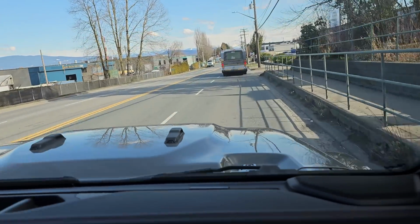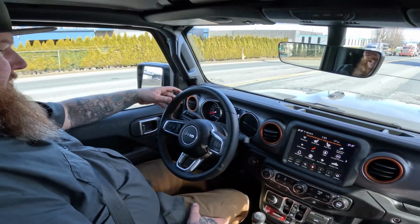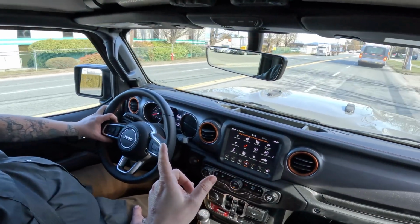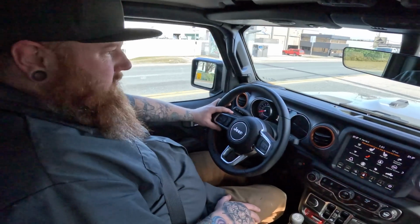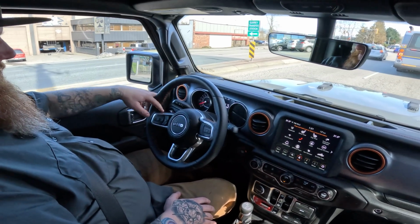Ride's nice. How's it feel on the steering wheel? Smooth? Ride's straight? So just so everybody watching knows, we need to center the steering wheel a little bit, but the drag link is too long. It can't go short enough. So we got to make some adjustments to the drag link at some point just to get that final correction in, but the vehicle is driving straight.